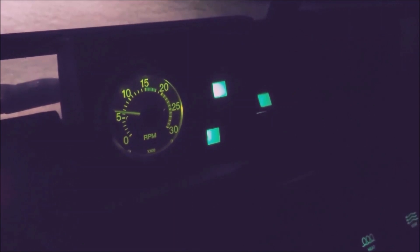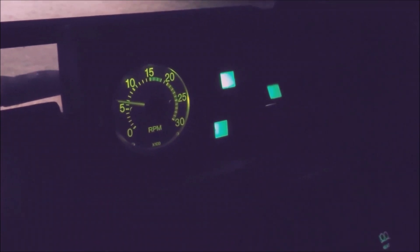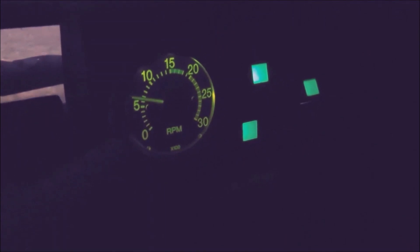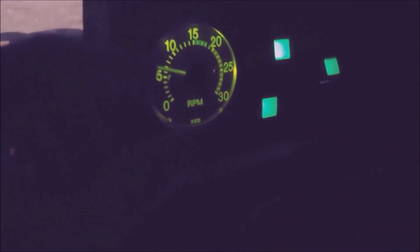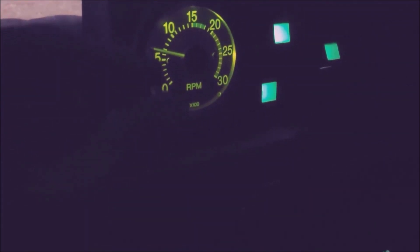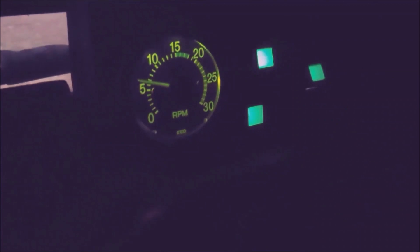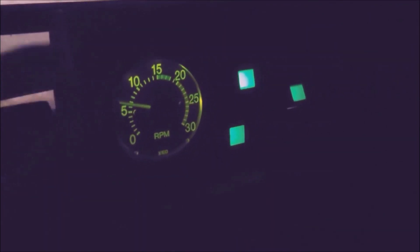The tachometer does work now, which I'm happy about. Most people don't care about having a tachometer, but I like having it to see where my engine's at — especially with the PTO it's nice to see your RPM. All the dimmer and buttons work like they should with the tach. The mag pickup may have been the problem, but I also opened the dash cluster up after changing it because it still wasn't working. On a lot of the connections there are those red covers that go over them with a zip tie. The zip tie had broke, the connector had walked apart, so the gauge wasn't connected. I'm glad I made some progress and got that fixed.